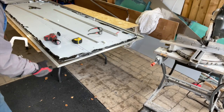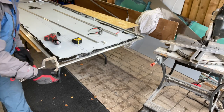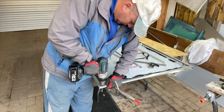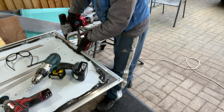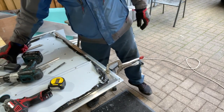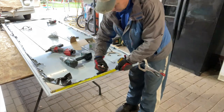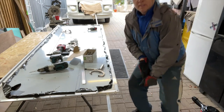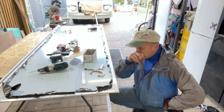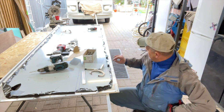Let's get it riveted up. I'm clamping the big one in first just to make sure we hold that in place. I'm feeling the end is nigh — we're getting there. This is the last sort of piece of the jigsaw on this flap — to get this edging trim all riveted into place, it's just a case of putting through another 30-odd rivets to hold it all in, which is a piece of cake with this new gun. This edging trim is giving us extra strength — lovely strength to it with that nice angle. Making sure it's all the same both sides. Thank goodness for that electric rivet gun because my hand would have been absolutely melted. These are super tough stainless steel rivets, really hard to pull up by hand, but we've got a really nice clean edge all the way around now.